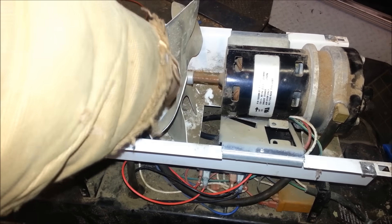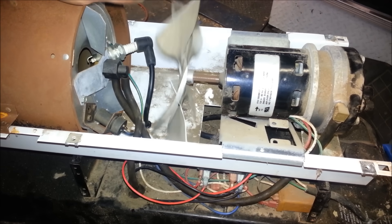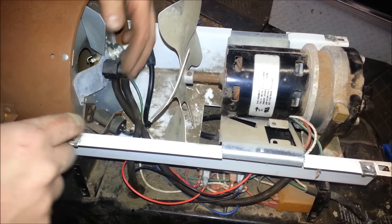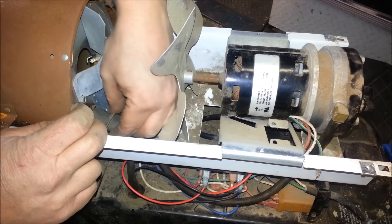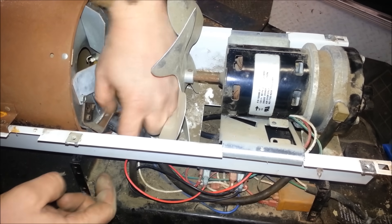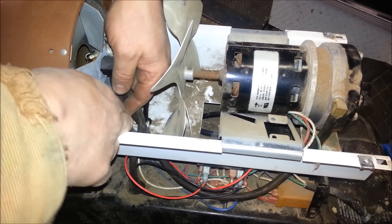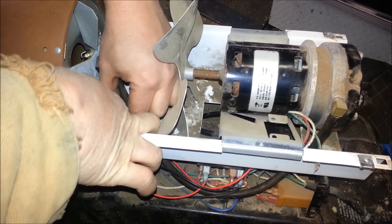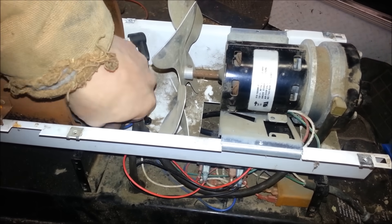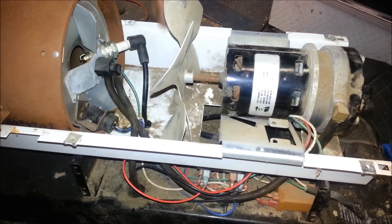Now, if I didn't tell you what the optical sensor does — because that can go out too. What the optical sensor does is if this is running for a couple seconds and it doesn't see light after a couple seconds into this optical sensor, it trips the little breaker back here on the back. But this can be replaced too — it does go bad once in a while. If you're having trouble with it just tripping — blowing heat and then just tripping — it's probably your optical sensor. Just make sure the screen is clean and make sure there's no spider web right in front of the little hole, because it's just looking for light.